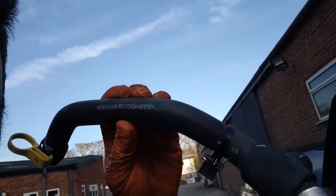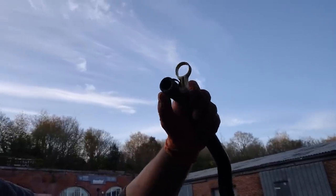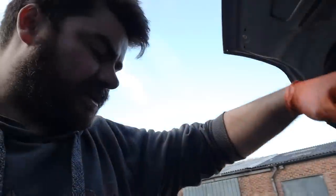Those clips are designed to be put on, not taken off. The reason they do it - you can see the Ford part number here - things are done on the cheap. On the production line it's got a clip in it and they just fit everything on the engine and pull the tag out. It makes sense for production but it means all the hose clips are done up the same torque, all in the same position, one at both ends - and you can't get them off. On the old BX and similar you can just use pliers to spring them together and let go. These are just awful quality.